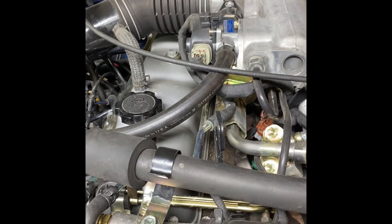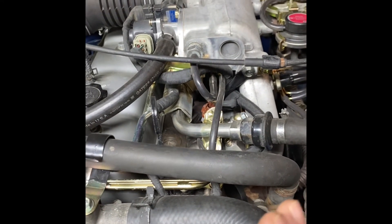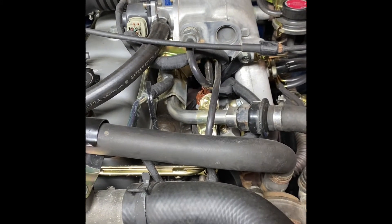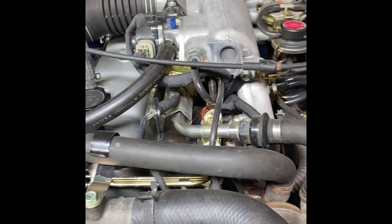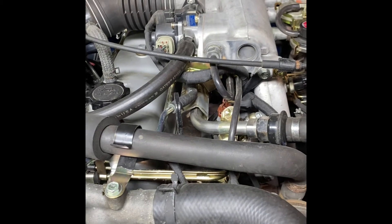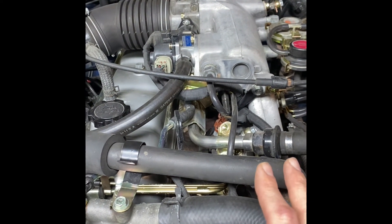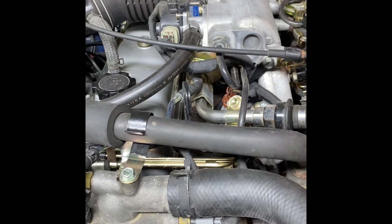The other sensors of course are the O2 sensors down below the truck — there's two of them, one on each bank. Those are a pain to replace if you've never done it; they're likely totally rusted in place. The only way I was able to get mine out was to drop the down pipes off the exhaust for better access. The connector for the second O2 sensor that runs over the transmission hump is a huge pain — some people have to take off the automatic shifter housing to get to it, though it is possible to reach it by hand.